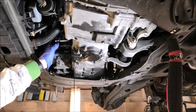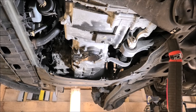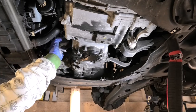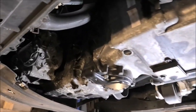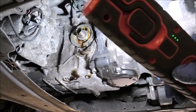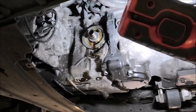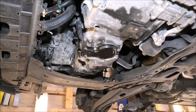It shouldn't be that tight at all. So I'm just cleaning the area where the filter sits a little bit. Sometimes some bits of oil, burnt oil or whatever, accumulate around, and then your filter can leak a little bit. So just give it a clean, and then we can refit the new filter.